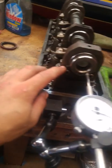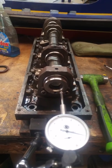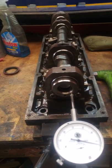Usually what happens is this plate right here will be worn out, or the cam itself will have a little bit of wear on it. So just refer to your specs and then from there you'll know what you need to do. Thank you.